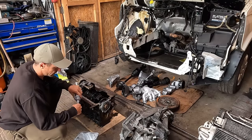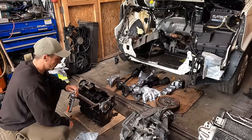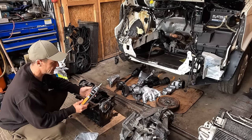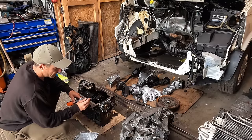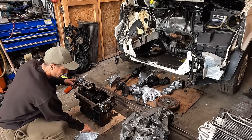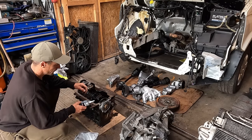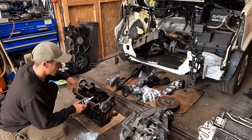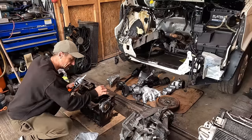Now look, I'm sure you don't want to hear the boring bits on putting gasket sealer on, but if you do have to use a gasket sealer, this is a Wins black gasket maker. If you do have to use this rather than a gasket, it's easy to put too much on. Now, if you put too much on, when you bolt the sump up, you're going to get loads splurging out the side. But not only is it splurging out the side, it's also splurging inside.